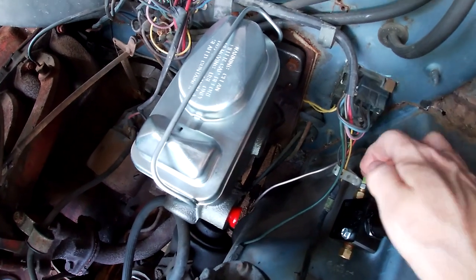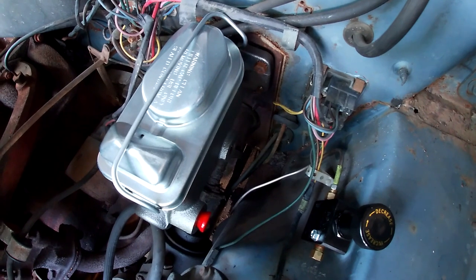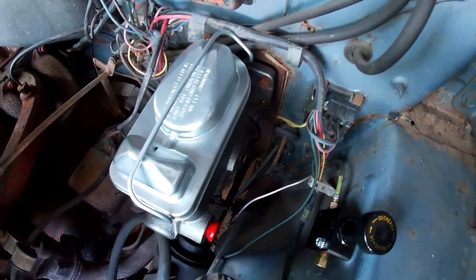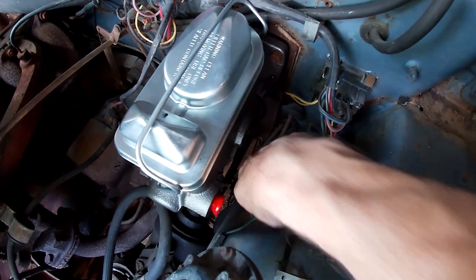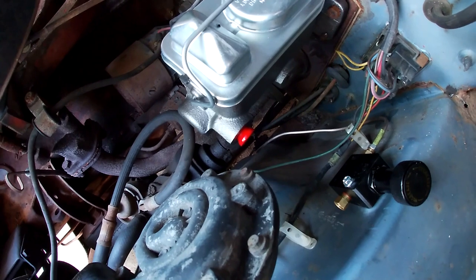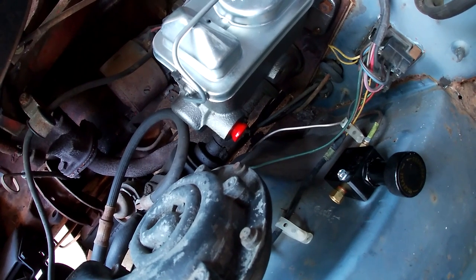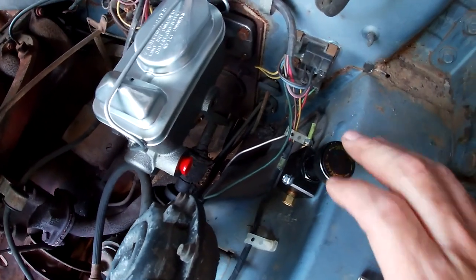And I didn't want to actually try to measure this and get it right. I know it's probably going to be a pain in the butt to flare the other end, because I usually put the flare thing into the vise, but I'd rather have it the right length. So it kind of snakes down to the original T. I got a little plug because you're going from one input and three outlets to one input and two outlets, because this does the rear.